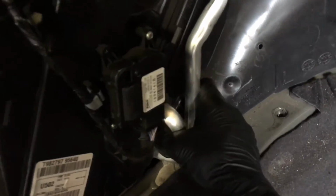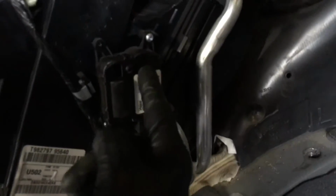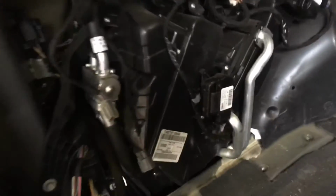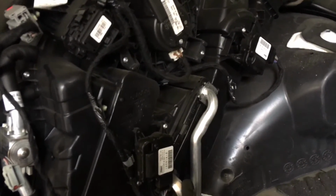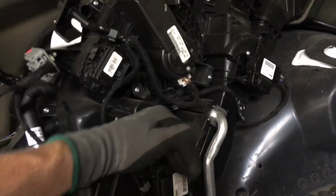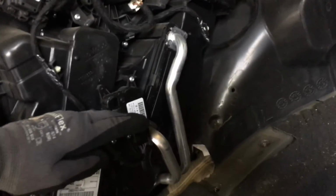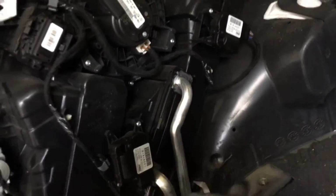If there's no hot coolant, let's see, on this one, it goes around, let's see. This one looks like it goes through the heater core. Some of them go around, some go through. They must have a valve to turn off the hot water on this one. Some of them, the hot coolant flows all the time, and it uses ducting to determine whether the airflow will go around a heater core or through a heater core. In this one, it appears it goes through. If they have no coolant flowing through this, it'll be cold air coming out on the other side.